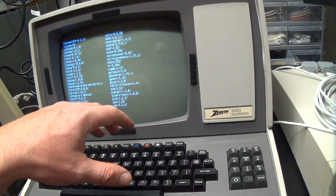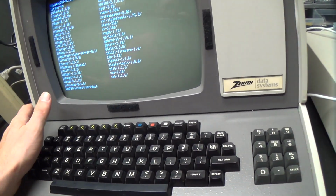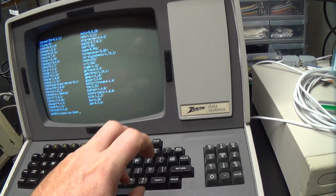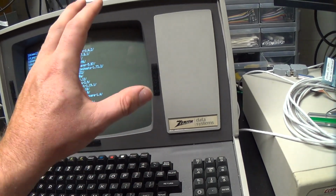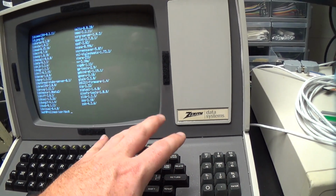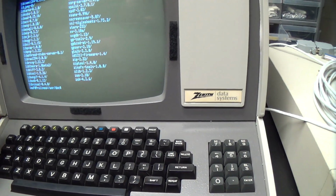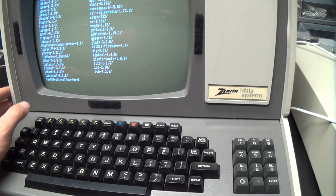But I think I can make it work like a virtual version of an old telephone crossbar switch. So there'll be 1 or 2 or maybe 3 serial trunk lines, and then 2 devices will connect to that line. So you'll only be able to have 3 sets of devices connected to each other at a time, right? But you can connect any device to any other device that way, and it won't use a whole crap ton of ICs and shit. So I haven't drawn any schematics for that yet, but I think that'll be interesting.